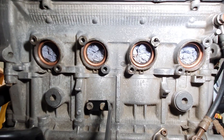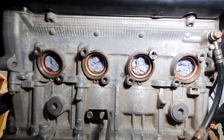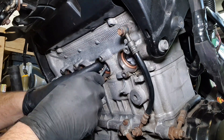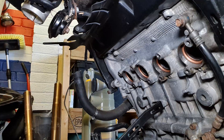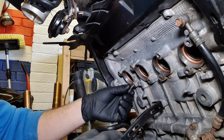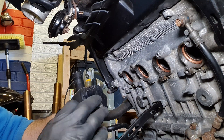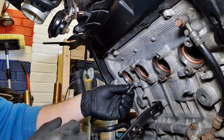Right, so another day on - let's have a closer look at what we've done so far. All the gaskets are in place now, everything's cleaned up, I can pull the tissue out now and get the exhaust fitted. So before I fit these exhaust studs or fit the exhaust, I'm going to put a little bit of grease on these threads and just run them in and out of the head just to ensure it's nice and lubricated. Hopefully it might just help a tiny bit as and when I need to take the exhaust off again, or just aid fitting as well.